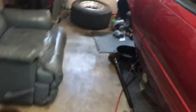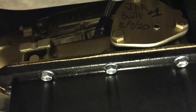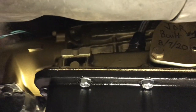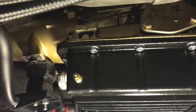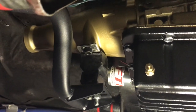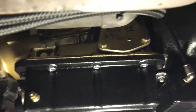The motor's all good to go. I was getting a powerglide from Jake — we got that put in. JDR built number one, and he painted it special gold for me, which I love. It's got an Ultra Bell on it, a 180 gear set, straight cut gears, FTI Pro brake, manual valve body, aftermarket input and output shaft, aftermarket tail housing. He said it's rated to right around 1500 horsepower, so we shouldn't have any more problems ever.